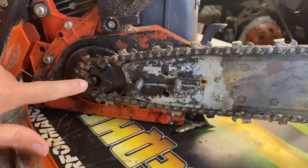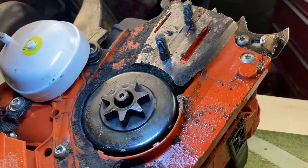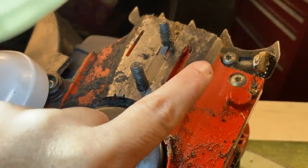The really bad part about this is the saw is only about seven months old and it's already had a $200 repair. The customer uses it commercially and one of his guys put the wrong mix of gas in it about two months ago, so he spent $200 just for me to put a new piston and cylinder in it. Now let's take a look and see what all is destroyed.